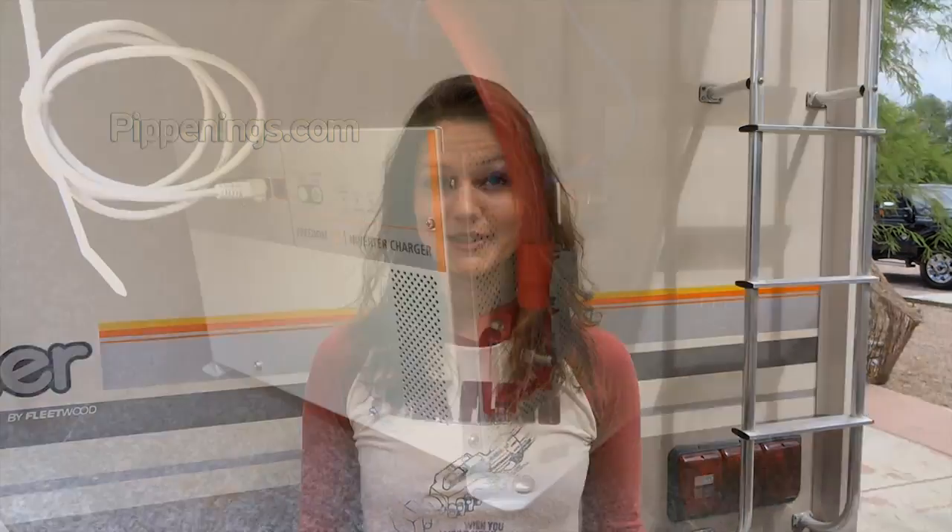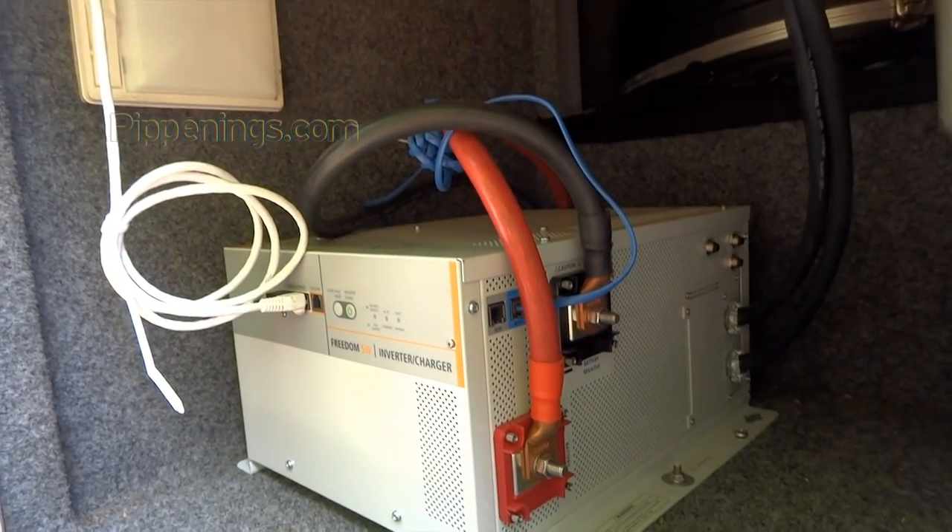So how do you run AC power when you're running off of your batteries? Either you can turn on your generator, which will create AC power and runs on gasoline — giving you both AC and DC power — or you can use an inverter. You can get a big inverter that powers your whole RV electrical system, or keep your converter and get a small inverter that plugs into a cigarette lighter and run off that. However, that will only give you like one AC receptacle, so you can plug in one thing at a time, and it has to be wherever your DC receptacle is.